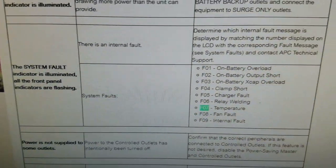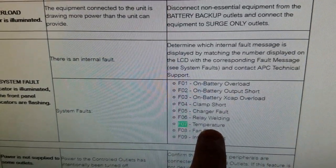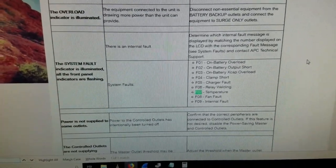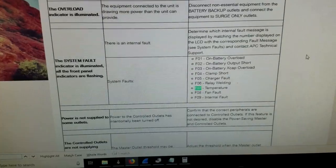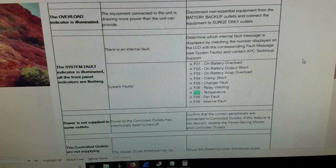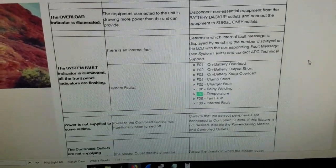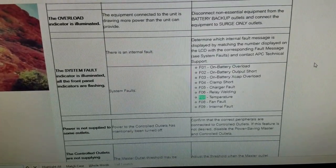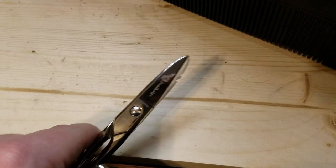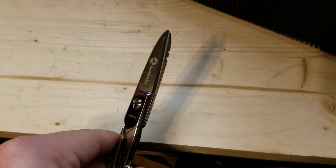So that was a temperature sensor, but maybe its normal state is open — disconnected. Let's cut the temperature sensor so there's nothing going through it and see if we still get the same F07 error. Thankfully APC gives us a nice little window to get to the temperature sensor in the battery compartment. Snipped the tip and broke the connection — let's see what it does now.